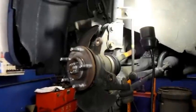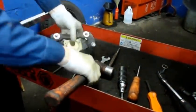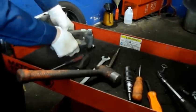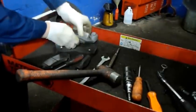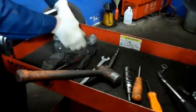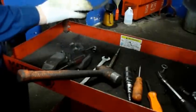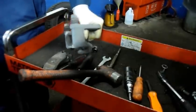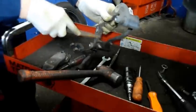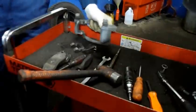I just want to show you something else too. We're going to change the brake hardware kit which is actually on here as well. See how these are pretty rusty where it fits right inside here, so we're going to change this hardware kit too. You just take these off like that. If there's rust on here, you want to clean it up — just take a file and file it just a little bit to get the rust off, not the metal, just the rust. In this case it doesn't need it, it's fine.